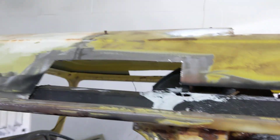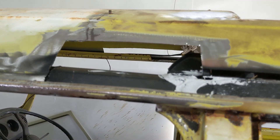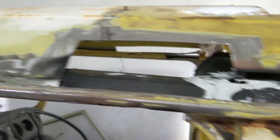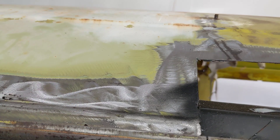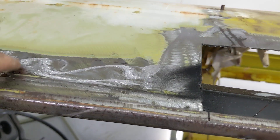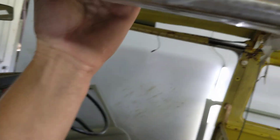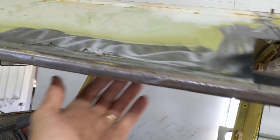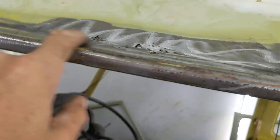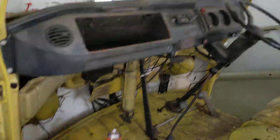Clean up all that in there. It's not mission impossible — it's just work it out, work it out in your head. I'm not happy with this here, so we'll probably cut a section out of that, just to make sure. Because the back of that is right behind here. Although we're going to flood it all with rust treater, if there's already holes here, we've just cut it out, weld a new section in. Fresh metal — that's what it's about.